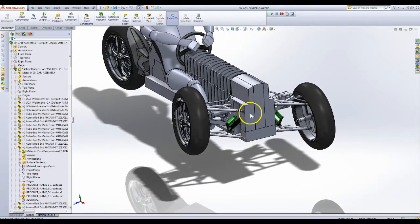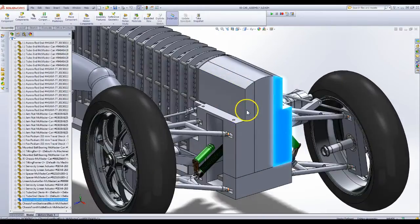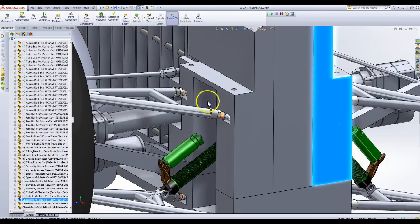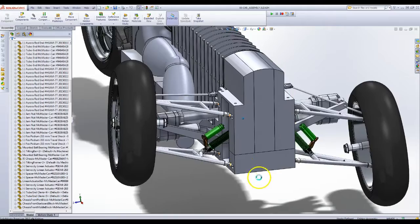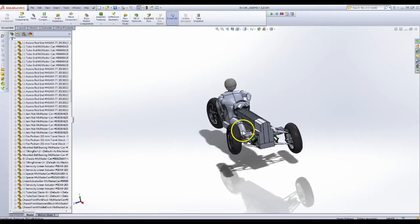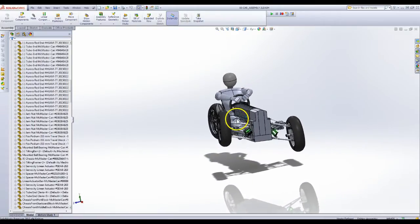I added these three big pieces of aluminum. My plan is to bolt them together and they will act as the upper part of the chassis. They will hold the pickup points for the upper A-arms, and then they allow the tilting frame — which you can see in here — to tilt. Right now I have it showing the car tilting, going into a corner.